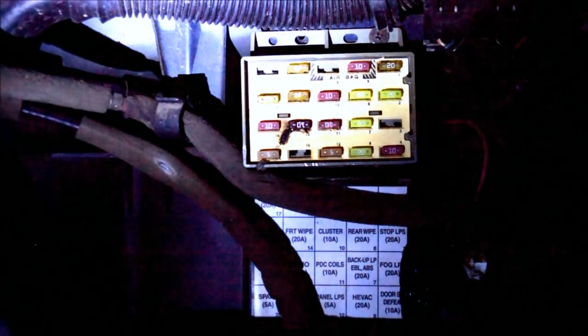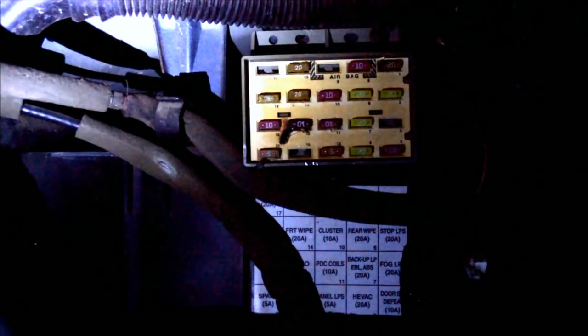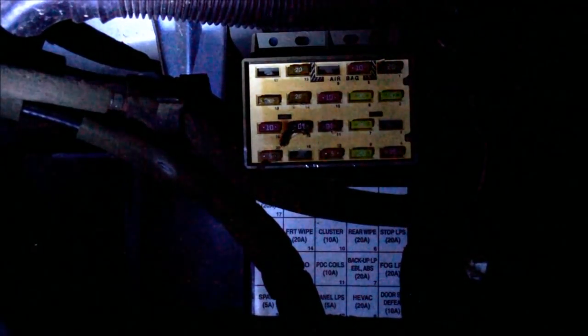Now I have a 97 so my fuse box will look a little different than yours, but here's what you're wanting to do. Number 19 is a spare holder — it holds a 10 amp fuse for most of you. You're going to take this 10 amp fuse, pull it out, and put it down in the number 20 slot. With a 10 amp fuse in the number 20 slot, the Jeep knows to bypass the clutch. It might even be listed on a graph telling you what the different fuses are for — that's a spare in 19, and you move the spare into slot 20, and presto.